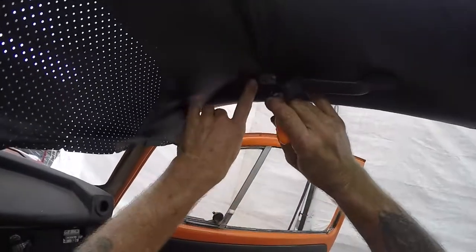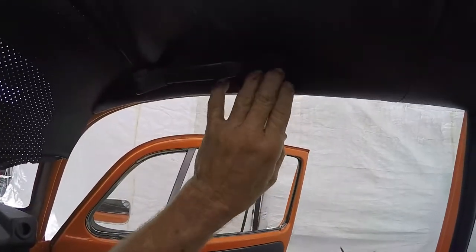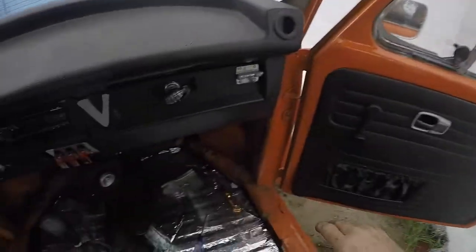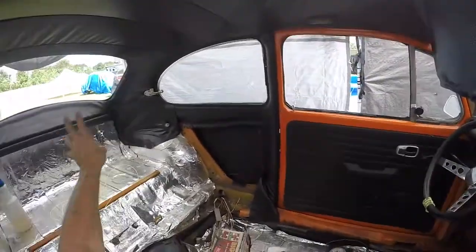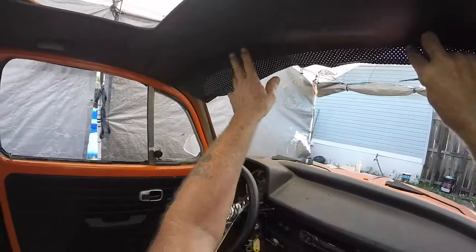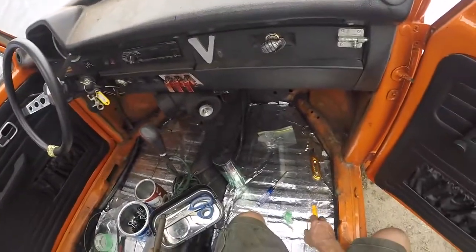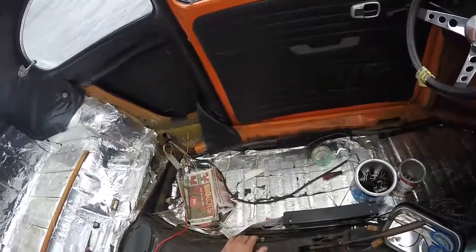I've got the oh-crap handle in. Just get a little pick and find the holes. I cut the hole out around the insulation so I could feel the impression and then use a punch to find the hole and drive your screw right through the headliner. Remember, this was not the correct headliner since it had more bows and didn't need the other three, but it actually looks fabulous. I've got my dome light in — it really looks nice. When the rear window goes in there it'll tighten up further, so that's fine.